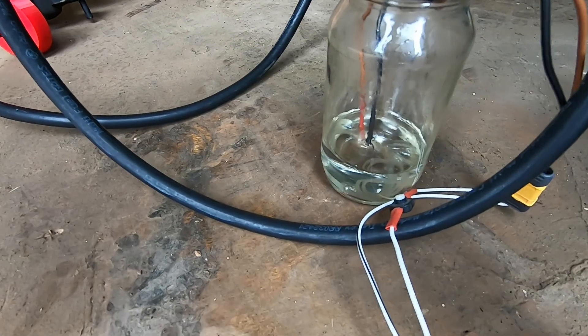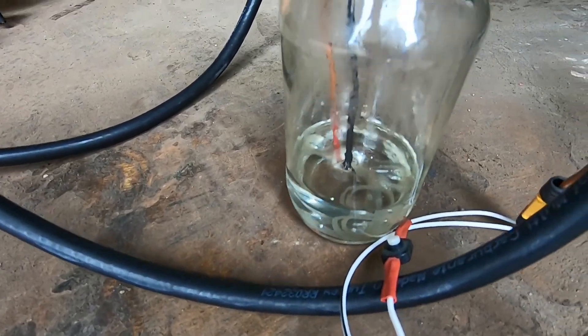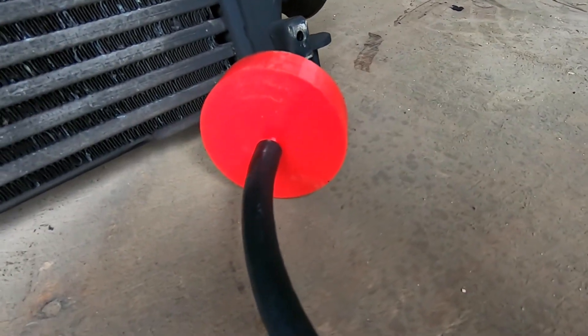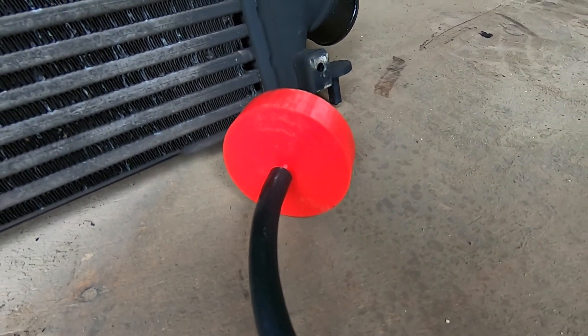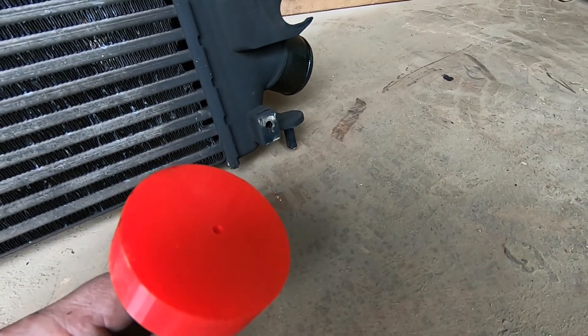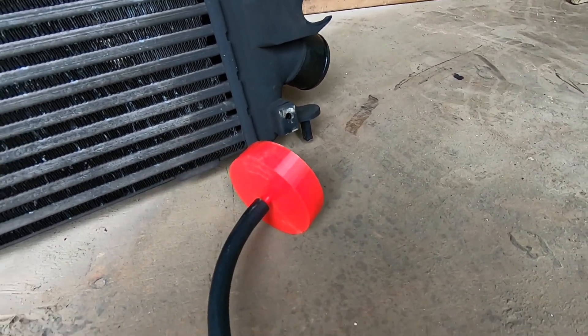So what I've done, I've built myself a little smoke tester - nothing too complicated. It's just a wick, heating coil, bit of wire coming out the top, two pipes, one in, one out. On the end of the output pipe, I printed an insert that fits into the intake nice and snug, and stops any smoke escaping from there.